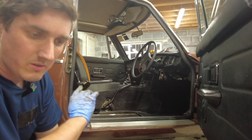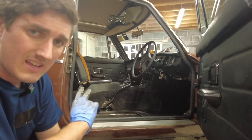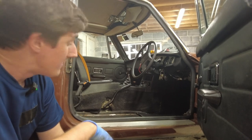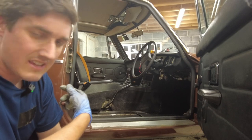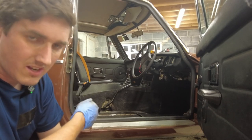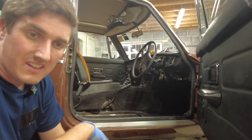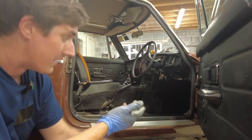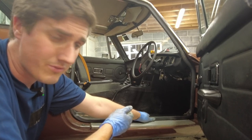At least we've got back brakes and a handbrake. The only thing we need now is to bleed the hydraulic system. Before I do that I want to check the rubber lines and make sure they're all serviceable - the metal ones look fine with no corrosion, which is fantastic. I'll slide under the car and check that rubber line that goes up onto the axle. I'm going to be flushing the brake lines anyway, especially considering the state of those slave cylinders - I think that's probably a prudent move.